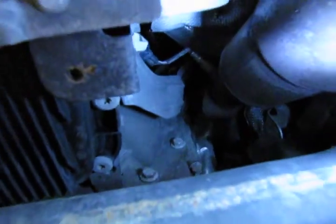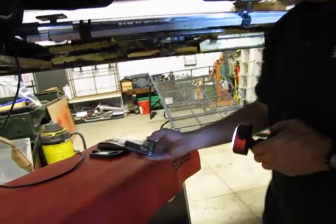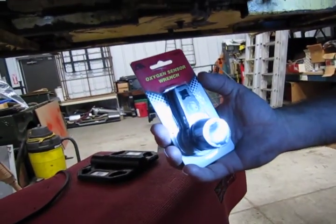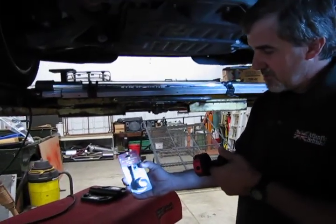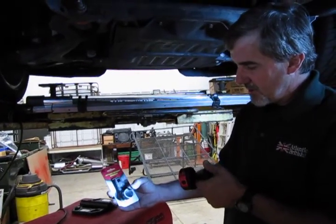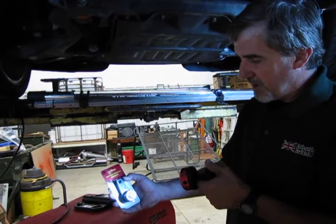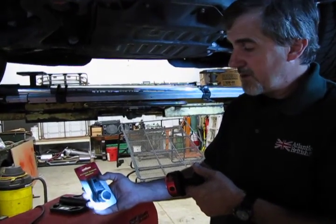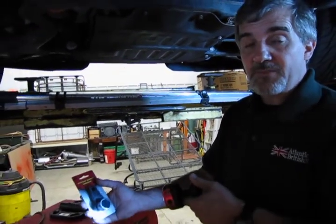As far as removing the O2 sensors, there are a number of different tools out there. We carry this oxygen sensor wrench, and by design you can either attach a ratchet or a breaker bar. I even use it to hammer on them — you can slide this over the O2 sensor, give it a couple whacks with a medium-sized hammer, and it actually breaks loose a little bit easier that way than using a ratchet or breaker bar. And once you break these loose, they pretty much spin out by hand.